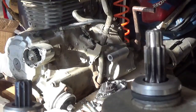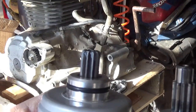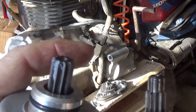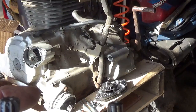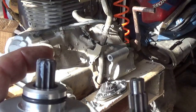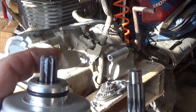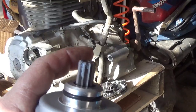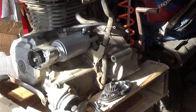This one here is the OEM starter and this one is the China copy. You can see there's a little tab on the OEM one — that tab and the bearing they have would actually keep things straighter, so you get less wobble, especially when you have a lot of torque on the starter. So the OEM one is clearly better than the China copy.